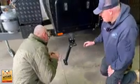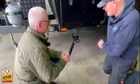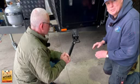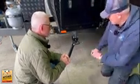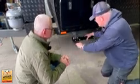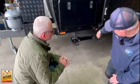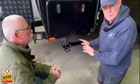One thing we would ask you please don't do is level the Caravan with these stands. If the Caravan's at a level, chock up the wheels, put something underneath the tyres, and then only put these down enough just to support each corner, to stop it from moving around. So there are your stands. When you're travelling, I suggest you store them pointing to the back of the Caravan.